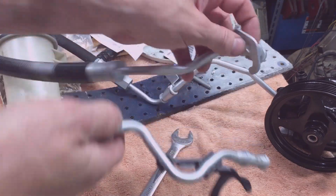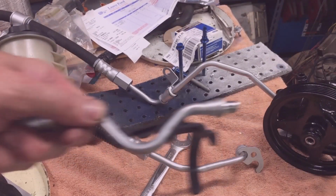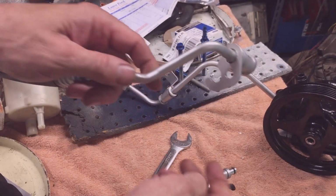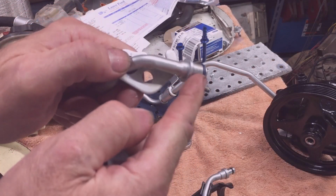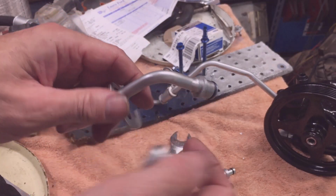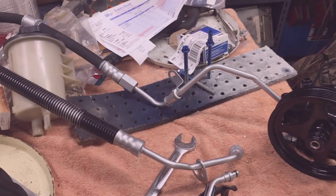Simply an O-ring, they should just pull right out. Once you've got that bracket off and the bolt off, they should just pull right out. This one came out pretty difficult, and this one is still stuck in the truck, so I'm still working it with PB Blaster, and I'm using a plumber's torch with MAP gas that my neighbor has. Still working on it. I'll show you in the truck.